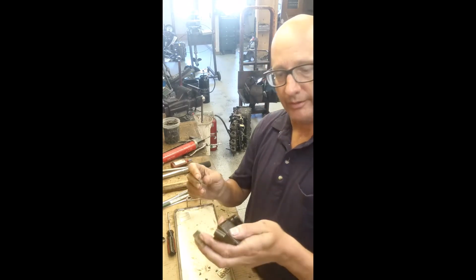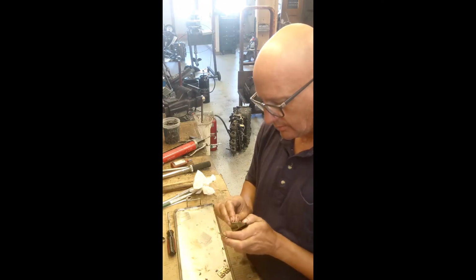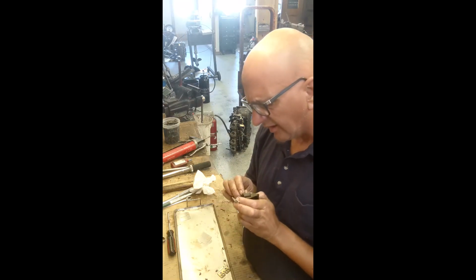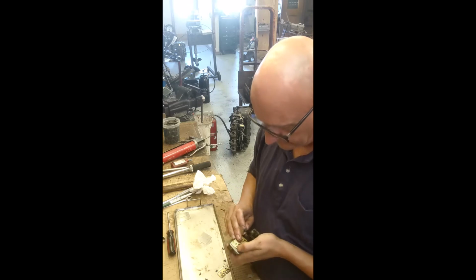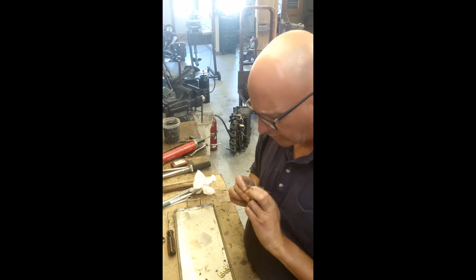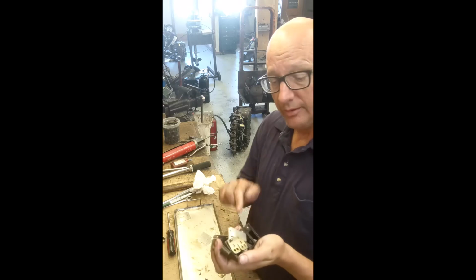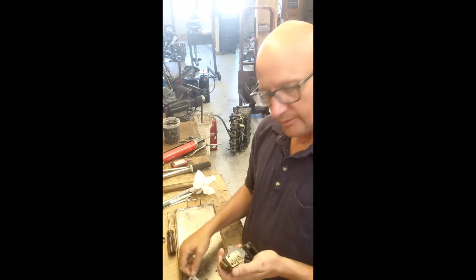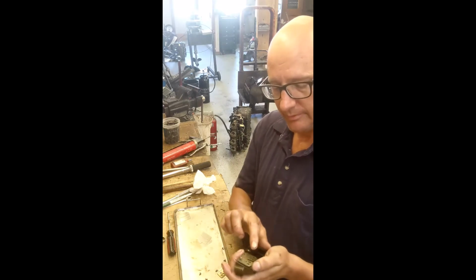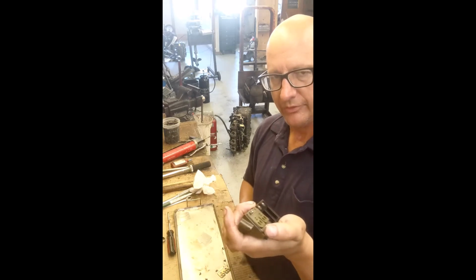The assembly like this is a reed stop. One small Phillips head screw. Line up. It's always more difficult when the camera's on. Get it started. If you leave that screw loose, it'll go into the engine and damage the engine drastically. You'll have to do it again. So check it 2 or 3 times. But this is one of 6 I have to do.